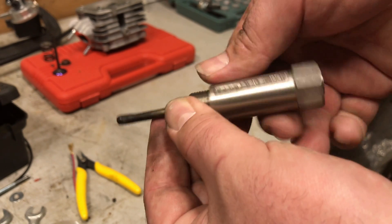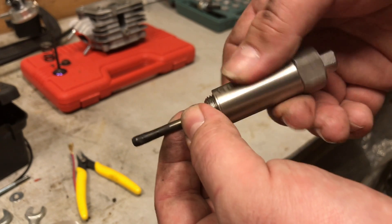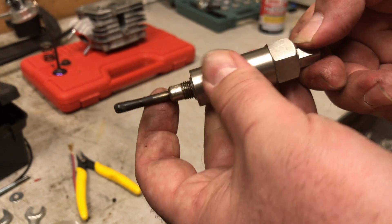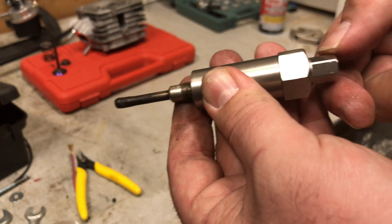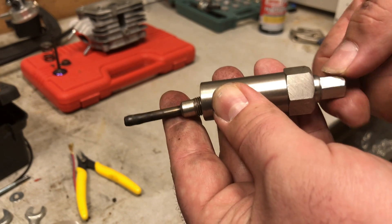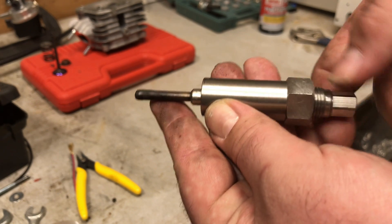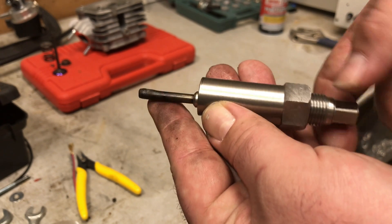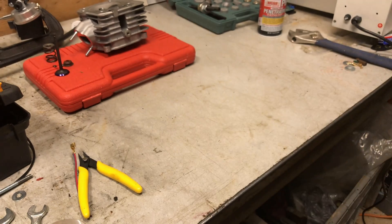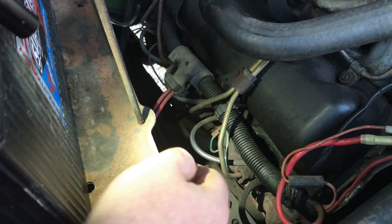What this tool does — the glow plug fits inside this tool, and then this threaded sleeve kind of screws down over the top of it. That sleeve fits up against the block. You can use the small nut to back out the glow plug, and once it clears the threads, if it's not wanting to pull out of the block, then you can turn the large nut — the sleeve — and that'll work as a puller and slide that glow plug right out of the block.